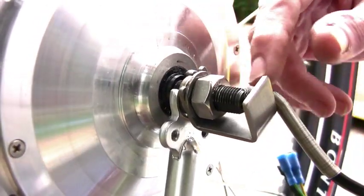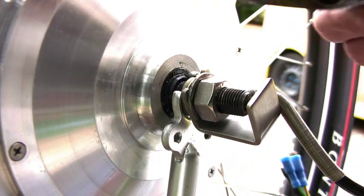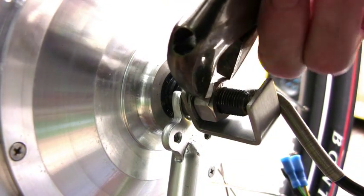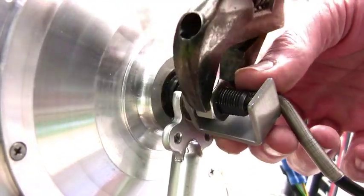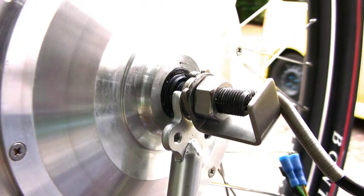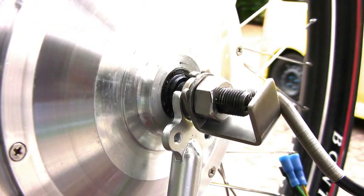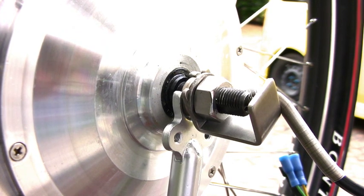Notice how this clever thing will protect the wires from getting broken. To make this waterproof — truly waterproof — I'm going to put some very thick grease. Here's my substitute for a 19mm wrench. We'll tighten this down somewhat, snug it. Go for a very short ride after it's snugged, and then we'll fully tighten everything. Everything should be made very tight, but not all at once. I'm an advocate of snug it down tight, run it for a while, and then recheck the tightness of any mechanical fastener.